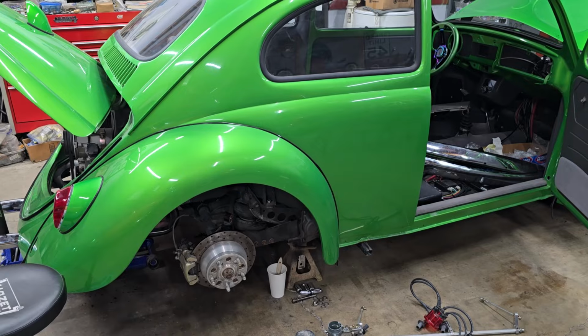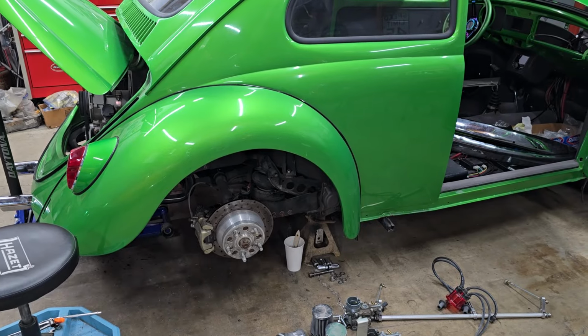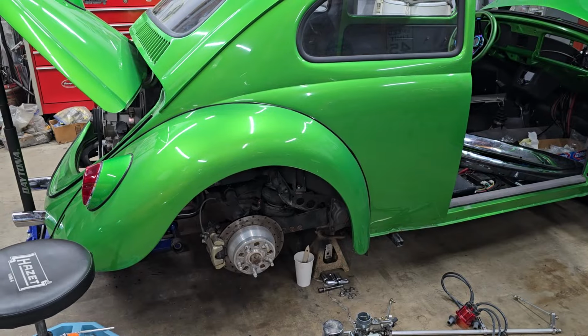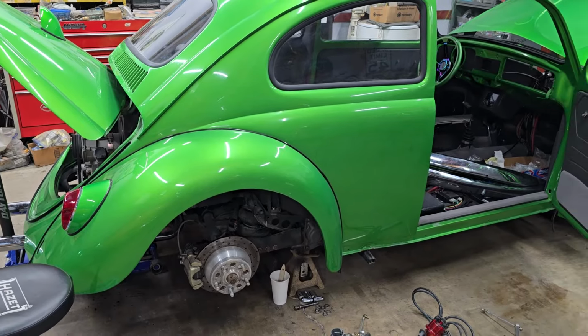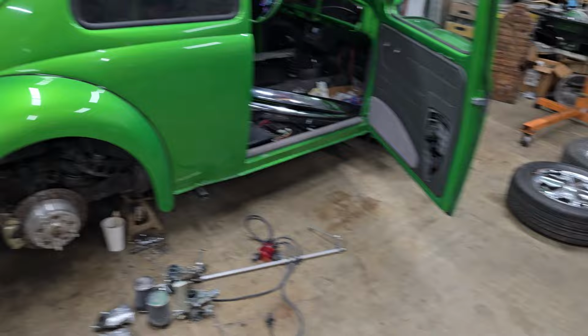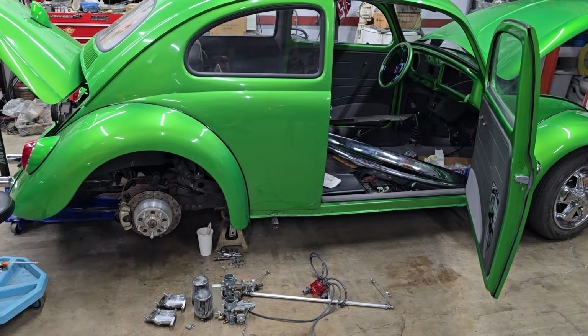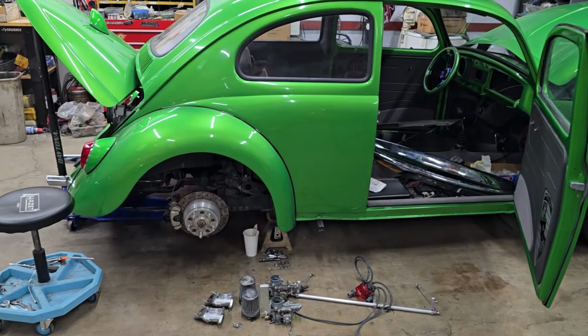Furthermore, one of the owner's friends, who like me is also an engineer and sounds like he spent a bit more time looking at the system here, said he was pretty concerned about it and about its safety specifically. So given all that, and the fact that the front system doesn't seem to be working that great, I am recommending to the owner that we remove the front and rear airbag systems and just put in static suspensions. So 2 or 3 inch drop plates on the back, adjustable beam on the front, and just slam the car as low as he likes that's still drivable, and be done with it and get rid of all this air ride nonsense. So he's going to think about it.